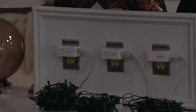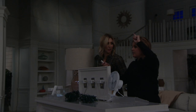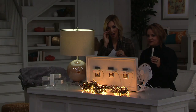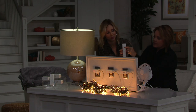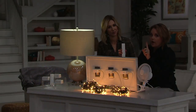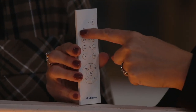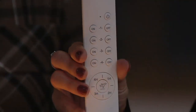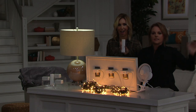You can easily label them or use master control. If you get multiples of these, can you use one remote for all of them? Yes! If you want to use all three receivers from this kit on number one — say all the lamps in the living room — you pair them with number one. Hold the button in, it will blink, hold it up to the receiver, it will blink, and they're paired. You can do up to four different receivers per button. With multiple sets, you could use one remote and control all kinds of things throughout your home.